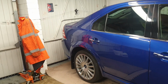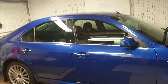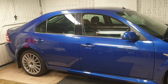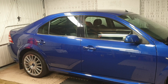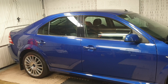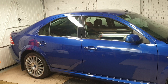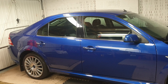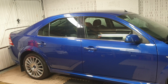And I think that is about it. But those two main ones I talked about right at the beginning, all the rot around the back. If you see a car and it's got holes in it and all the rest of it, then you need to be seriously considering whether you want to be getting into that. A lot of people say, oh yeah, it can be welded up and all the rest of it. And it probably can, but I question the structural integrity of the car, and what other rot you can't see within the cavities of these chassis members, because there's a fair bit of box section underneath most cars, and you just can't see what's going on inside.